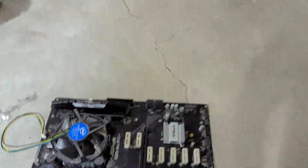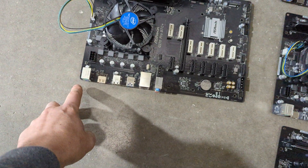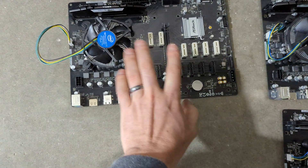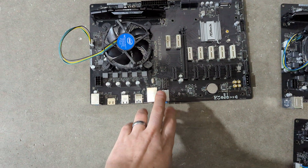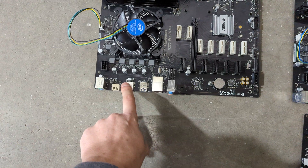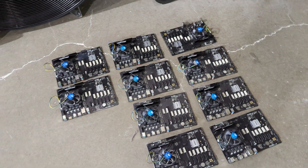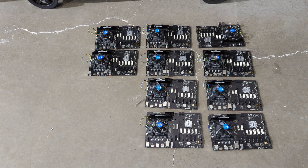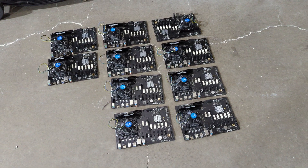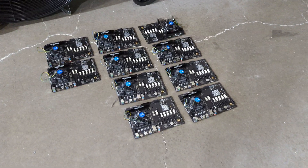We're setting these guys up — I have about 30 of them, so imagine how long it's going to take. What we also do is after setting them up, we put three plastic pipes across this side, this side, and the middle, so the board doesn't sit on the bare metal of the rack — it sits on plastic pipes that don't conduct electricity. The first thing we do is boot it up, make sure it runs, then update the BIOS. We turn off HD audio — we don't need that. We turn on power cycle so it goes to auto power-on if it loses power. We also turn on display output for the CPU because the CPUs we purchase have UHD graphics, so we want to run off UHD graphics, not discrete graphics. We go into the BIOS and change it to UHD graphics.